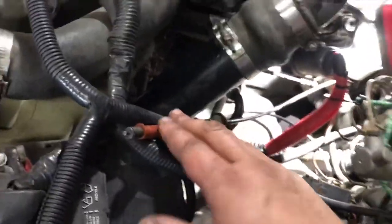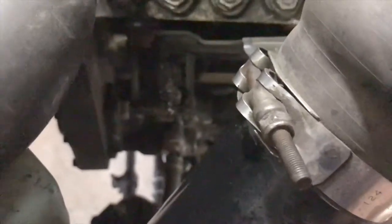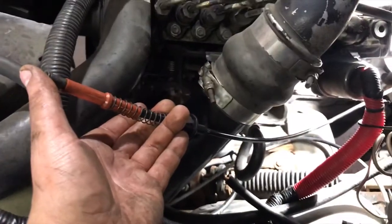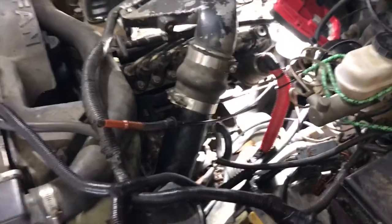Let me take off the throttle cable and see if it's free. Update time — figured out the throttle cable situation. There's the throttle cable stock to the Ford F-350, and there's also a return spring to the p-pump which connects on this linkage here. Between these two springs — one down there and one here — when you push the throttle, you're fighting two springs, which makes for a very heavy pedal. That might also be what the cruise control is struggling with, having to fight two springs while the vacuum is trying to hold it at a certain RPM.